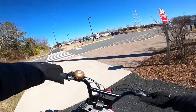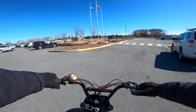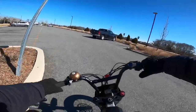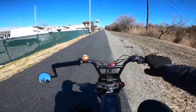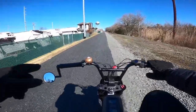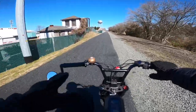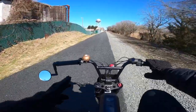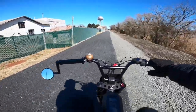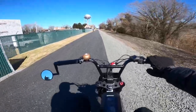All right guys, I know I said I wasn't going to do this but I really do miss it. It's still fun. I'm just not going to hit like huge, big, crazy jumps. Another difference I think we're going to have on this bike — one time I was riding on the beach on the sand and the motor just cut out and shut off. It wouldn't turn on for like 20 minutes. I think the wires got too hot. With the thicker upgraded wires going to the controller, we're not going to have that problem.